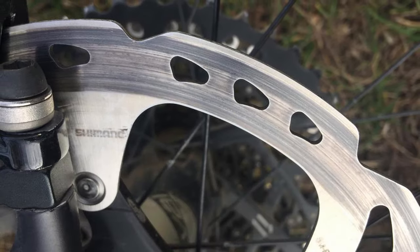Also, because of the increase in power, I can run a 180 millimeter rear rotor and it's super powerful — sometimes it just locks out. I was considering a 203 millimeter rotor for the rear, but I really don't need it. I weigh 215 pounds and it works great on the back tire. The weight penalty of over 100 grams more is well worth it to me when it comes to performance gains and long-lasting equipment reliability. I can't tell you how many Shimano rotors I've gone through.